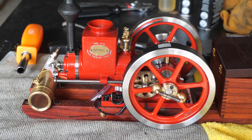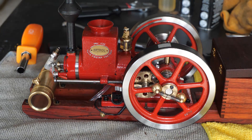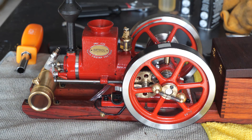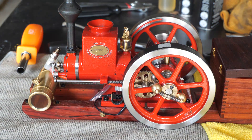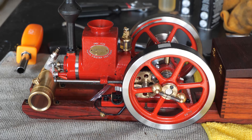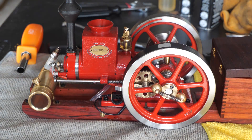Upping the voltage on that ignition unit solved my problem just long enough for it to go out again. Since I'm replacing it, I will put the stock ignition unit on it. That yellow one is the one that had a wire long enough to reach to the plug in front, and I swapped it in because the stock ignition didn't have a long enough ignition lead to reach the plug.